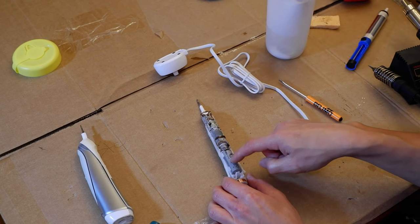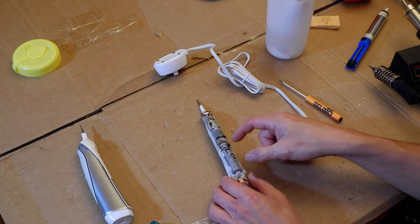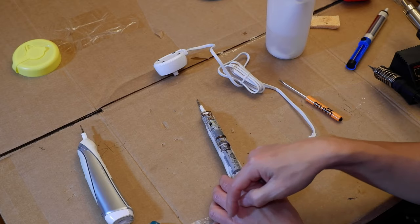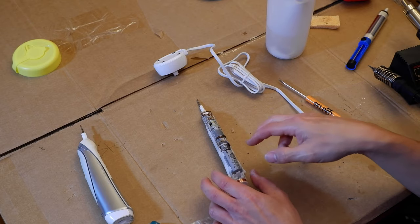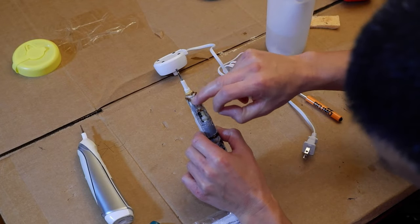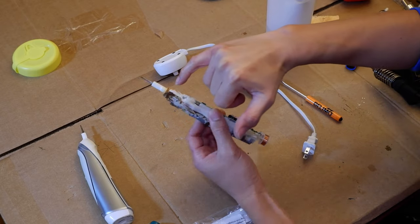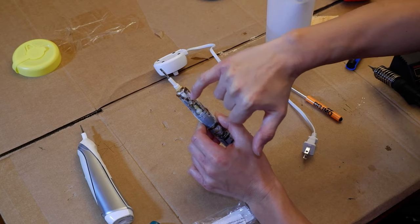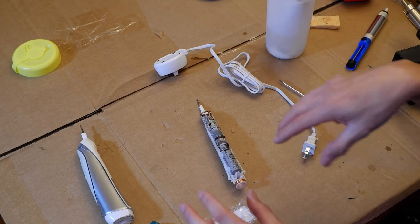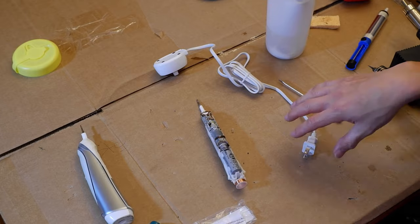This toothbrush uses a 42mm battery. They make two different batteries for these — some brushes use a 48mm or 49mm — so you might have to open yours up before ordering just to make sure you get the correct one. Also, while handling it, the little LED indicator fell off; it was attached to thin wires. I'm going to find a replacement LED. Before I get started on that, I'll open the other toothbrush to check if it's corroded too.